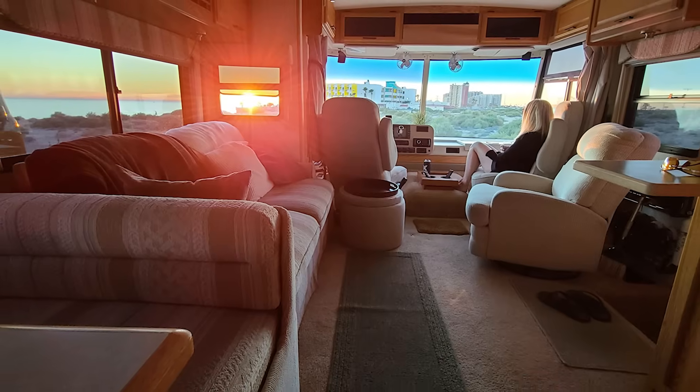We've got quite a temperature split — outside is about 90 degrees and the air coming out of the AC is around 40 degrees, so that's about a 50 degree temperature split, which is pretty impressive. We're in a 34 foot large motorhome with the slides out, and it's maintaining about 79 degrees inside. Folks in a smaller rig like a 24 footer are also reporting pretty good results.